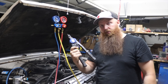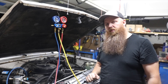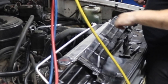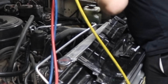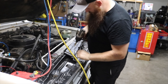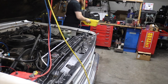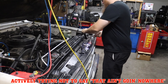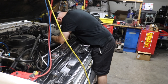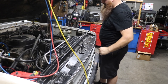I've got a couple of rivet nuts and screws and a rivet nut gun, and I'm going to drop some rivet nuts into the top of this radiator to see if I can bolt this thing in properly — not just flopping in the wind held by hopes, dreams, and zip ties. There just happened to be enough headspace on this center lump mounting bracket that I could drill and put these rivet nuts in. Radiator is now very solidly mounted — the bottom swings a bit but we'll have to work on that.